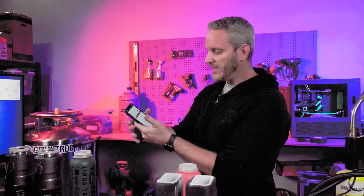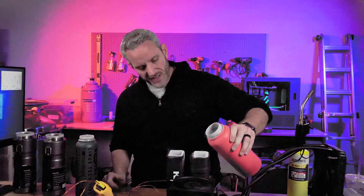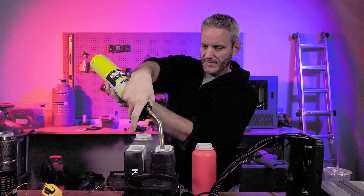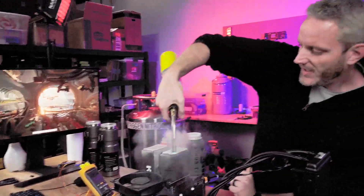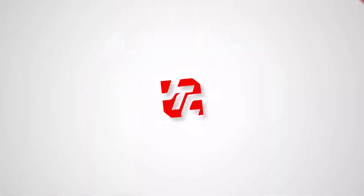I'm at 30,259. Slinky PC is right behind me at 30,184. Corsair is at 29,788. Kingpin's at 33,758 — he hasn't revisited SLI in quite some time. That's only at 2,550 MHz on the core, which I got on single card, but I'm fairly positive I will not get anywhere near that today. They're within like 60–70 of each other. It crashed at 2,400, which is significantly less than the 2,565 we were able to run on single card. So as you can see, things in SLI are much harder. I think I need to up the voltage.